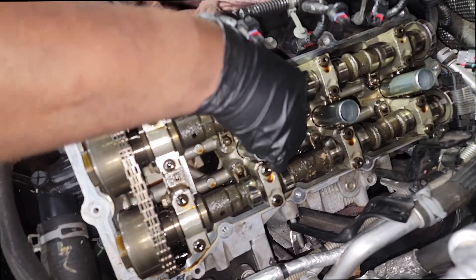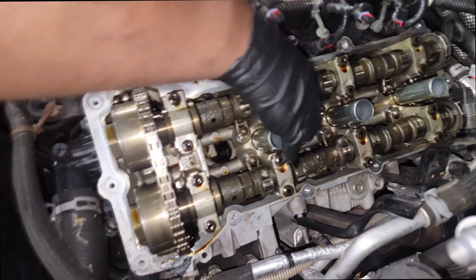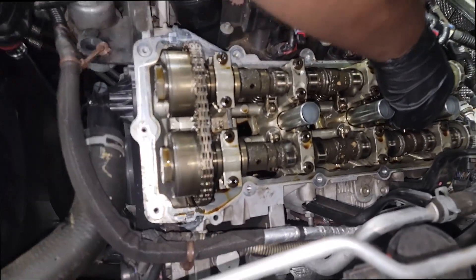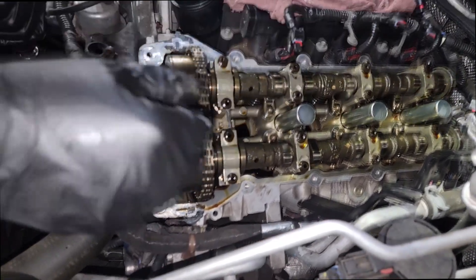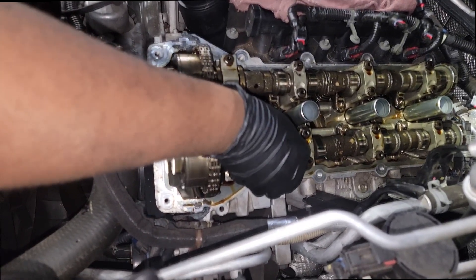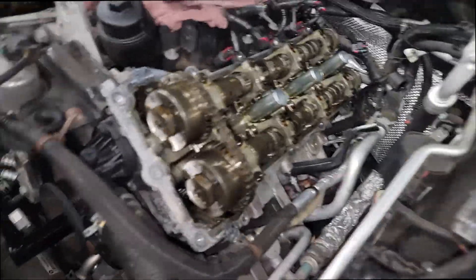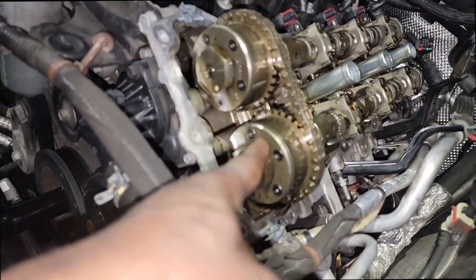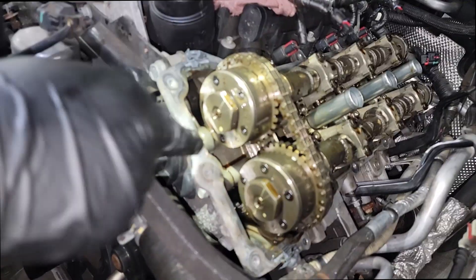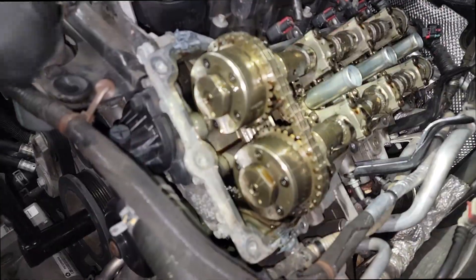You don't have to press down hard — if it's loose, you'll know. Like this is loose — basically not that one. I don't see camshaft damage, so we might get lucky. Sometimes if you catch it early enough, which it looks like we did, you're not gonna have camshaft damage but you will have a failed rocker arm. In that case, you might not see it until you get them all off because we actually heard the ticking. Turn the crankshaft enough to put the engine in time — we want top dead center up.